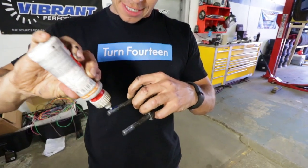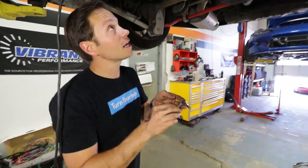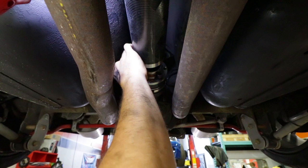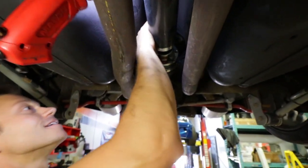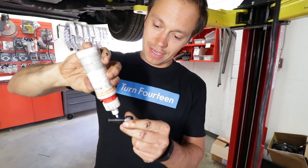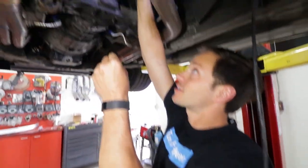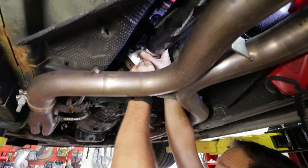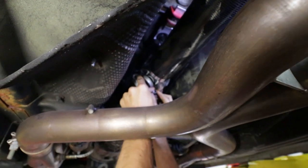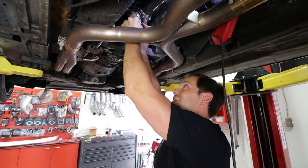Get thread locker on there - it's like a little game: green is up here, line it up, slide it in place and bolt it in. More thread sealant on the M12 bolts supplied by QA1, securing the front of the driveshaft to the transmission. These get tightened to 85 foot-pounds. Once these are all in place we'll go to the back and tighten those ones up too.